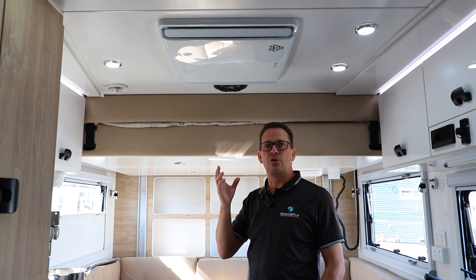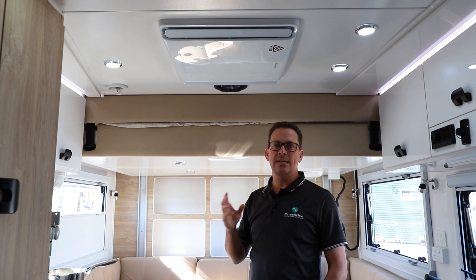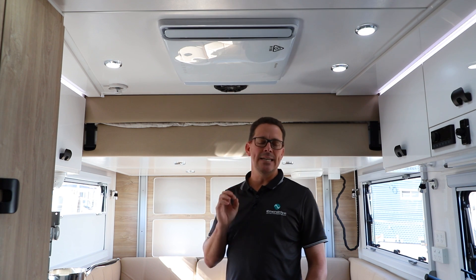It's a cold morning so the air conditioner is set to 16 degrees. We've got around 10 amps of current draw from all the LED lights in the caravan, so the total current draw at the moment is around 67 amps. With the lights off it would be around 57 amps for the air conditioning unit alone. With a 200 amp hour lithium battery and no charging source, that gives around a three-hour runtime — with a little buffer at the end.